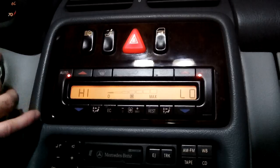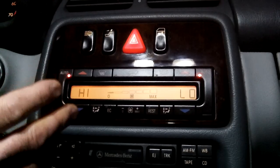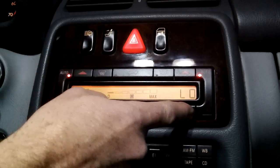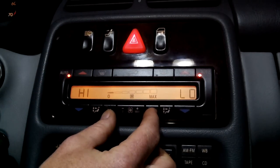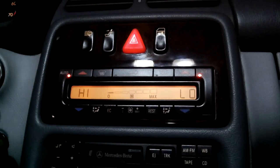The way you do this is you turn your key to ignition position two, without turning the engine on. You set the left side to high, right side to low — so as you can see it's high and low — and then simultaneously you're going to press EC and REST, and hold them in until the recirculate light starts flashing.